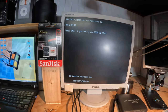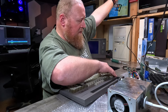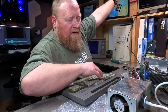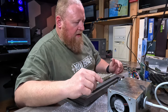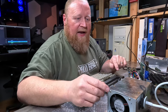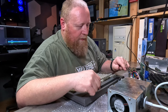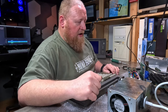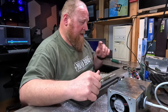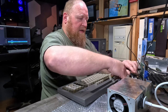Actually, I don't have anything going on on this keyboard. I don't have number lock, caps lock, nothing. That's the deal — that's what's going on. I'll bet you this battery died and probably took out the keyboard connection. I bet that's what a lot of those traces were for — keyboard. So yes, it posts, yes it comes up, but no, it does not have a keyboard.